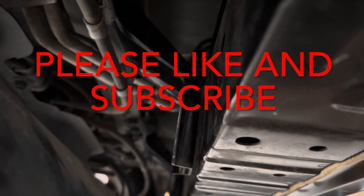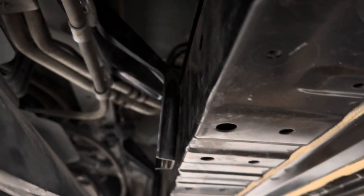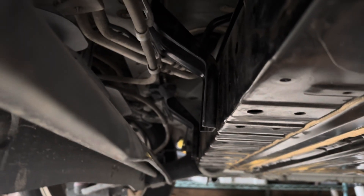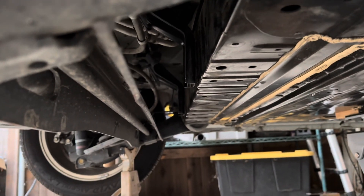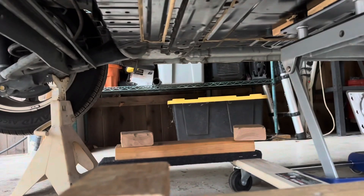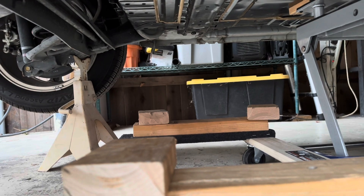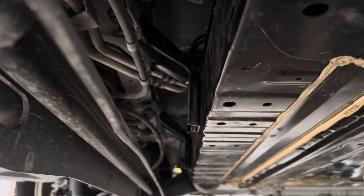While it's on those dollies you have pretty good maneuverability, but how are you going to know where to maneuver it to? There are the battery brackets — when you put those in, they're meant to be put in loose so you can maneuver them around. You have to line up so that when the back of the battery comes up, it misses them. So I put the laser level touching both of those brackets, knew that was a parallel line, then maneuvered the battery until the back end was perfectly in line with that laser line. When I went up, it would clear them perfectly.